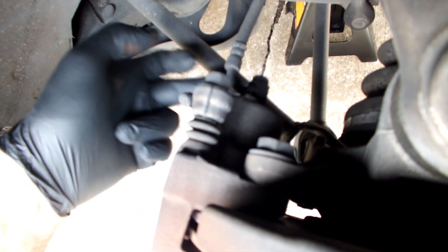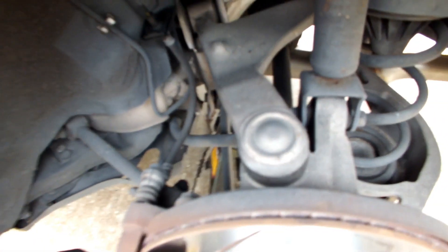The front's done, so walk over to the back. Back is a similar thing but with fewer bolts — you have the fitting, the bleeder, and the banjo. Just keep in mind to keep the position of these angles relatively the same. In this case it's almost like a 90-degree bend, kind of parallel to the ground.